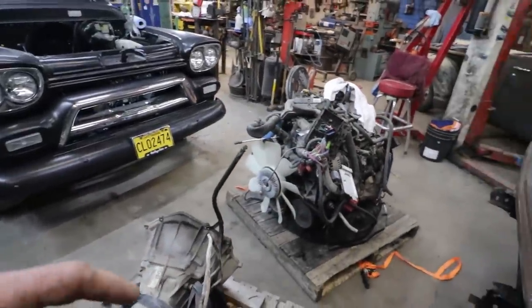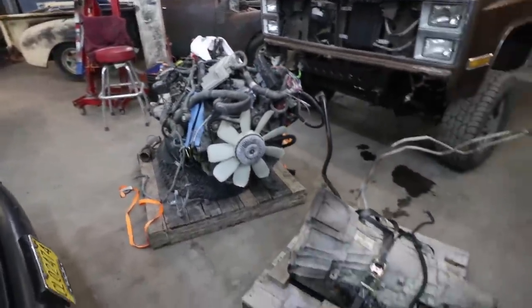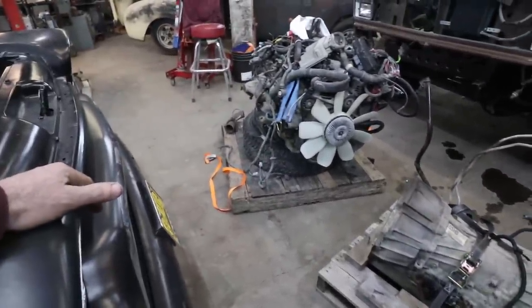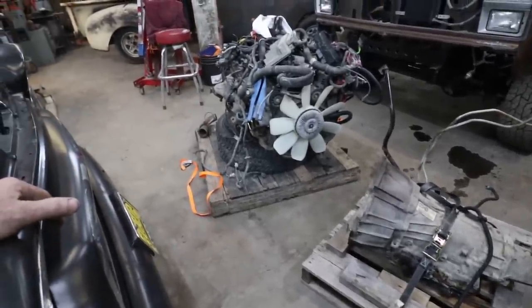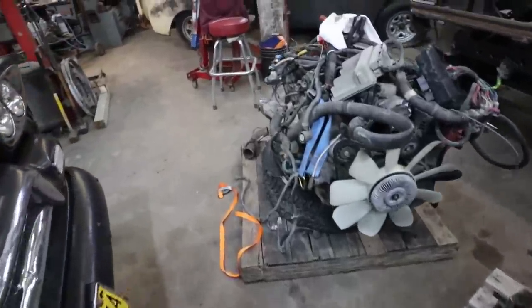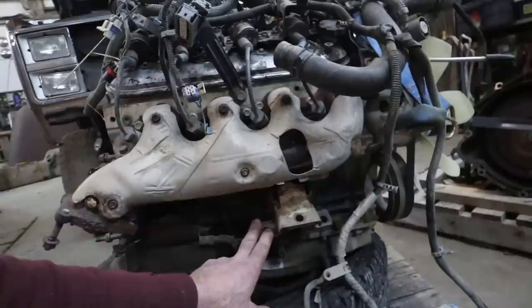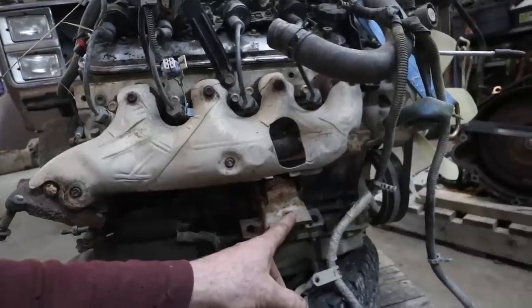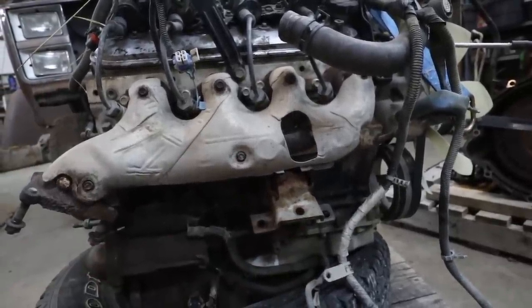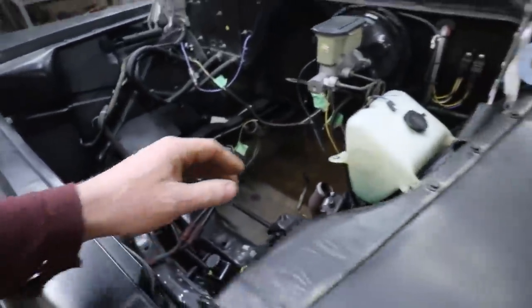Another late night and a really crappy start. So I guess tonight my plan, whatever, 10 o'clock, and honestly I'm not really feeling like doing a lot. I guess what I'm gonna do tonight, just so I get one thing done, is pull this motor mount off and build an adapter plate, like the motor mount for the LS, to go from the LS to the regular GM mounts. So with any hope, she's gonna fit in the same place.